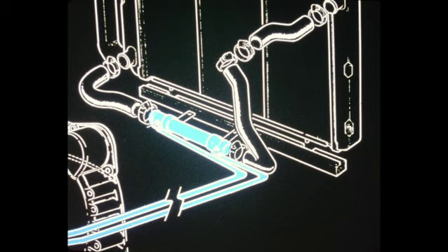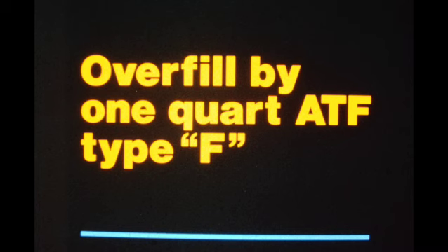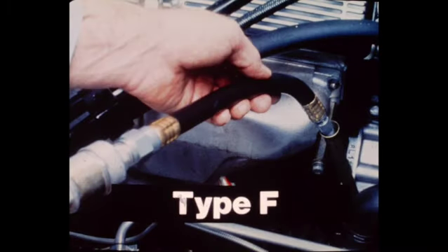Coolant contamination, as evidenced by milky oil in the system, indicates a failure in the transmission oil cooler assembly. If flushing equipment is not available, follow this sequence: install the new transmission but leave the rear cooler line disconnected from the transmission. This is the oil return line and can be accessed through the plate on the left side of the transmission tunnel. Overfill the transmission by one quart of type F ATF. Then operate the engine just enough to flush one quart of fluid from the system into a suitable container. If in doubt, additional fluid should be flushed through the cooling system to ensure that all contamination is removed. This will eliminate premature failure of the new unit. When flushing is completed, recheck the fluid level and add type F ATF as necessary.